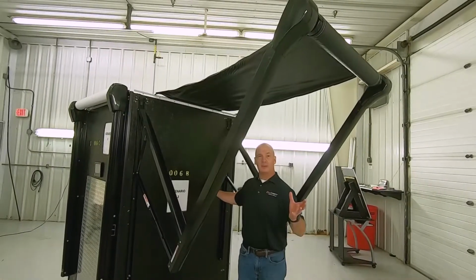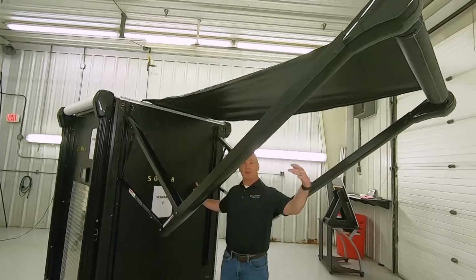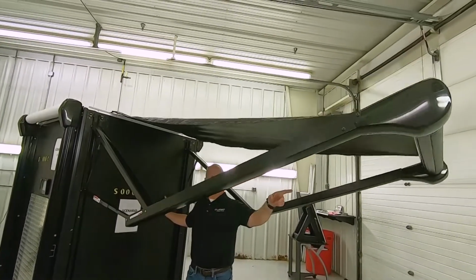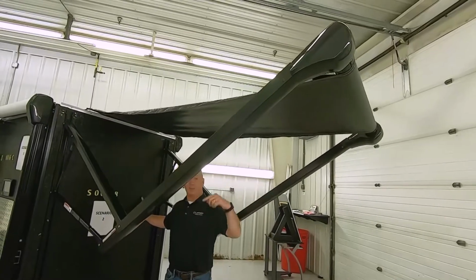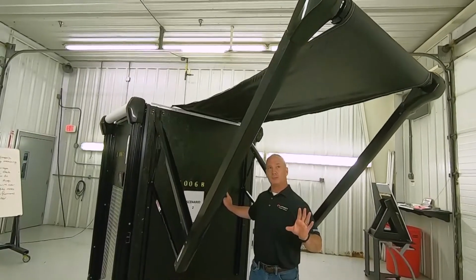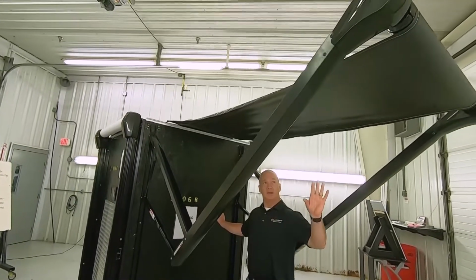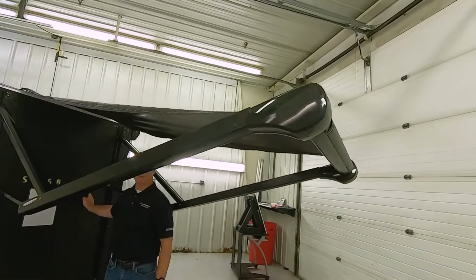Press and hold the extend button past the full extension. It'll actually then reverse and roll up backwards, and I'll show you that right here. So it'll actually roll that back up. And you can use this to clean your awning and some other things, but extend it back out and you'll watch the awning will actually then reverse and then roll back up the way it's supposed to.